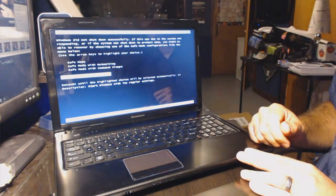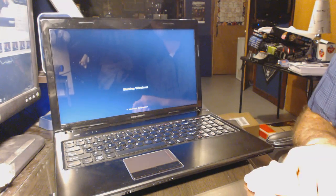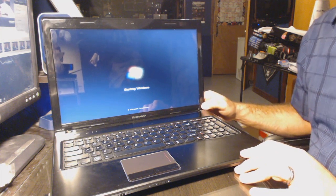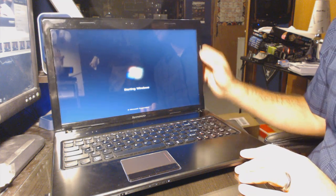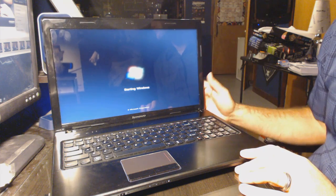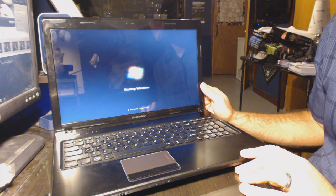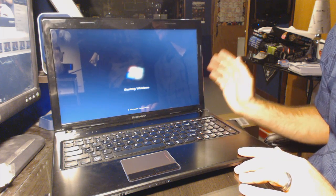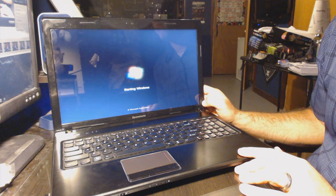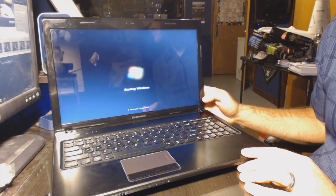We came up with a Windows Error Recovery — that's because we had a problem with the computer. We fixed that problem, so we're going to start Windows normally. While Windows is starting, you can look up the error codes like I said, with any manufacturer's website or a simple Google search. Just search the type of beeps — whether it was two or three beeps, a long beep, or short beep — and how long it took the beeps to stop and start. You should be able to find exactly what the problem was. It might have been several beeps for a hard drive issue, or several beeps for a CPU issue, which is your computer processor.